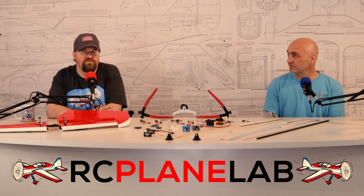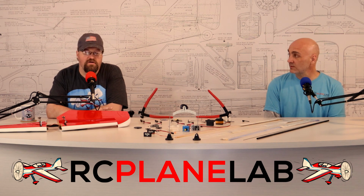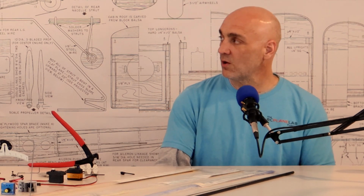So just to make sure, you use the farthest out hole that you can use? If possible, yes. And what that does is any slop that might be present in the system, the farther out you go, the less effect it has on the overall system.